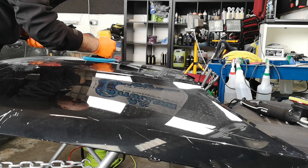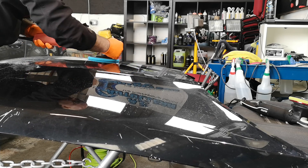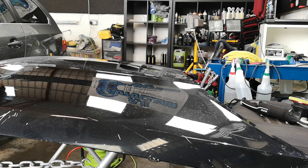Hopefully you can see — no dusters. I'm going to bring the camera over here just to show how this should look. Sorry for the shagginess of it here, and remember we had this strike-through at the start, so excuse that. But that's looking like there's hardly anything on the panel — it's just a greasiness. This is how far you should be taking this system. There's no dusting to it when you're using it correctly. It should go almost fully transparent, and you can see the metallic come through. So I wanted to stop at that stage just to show that slickness — that is what you're looking for when you're working this correctly.